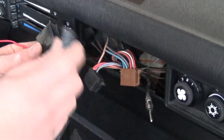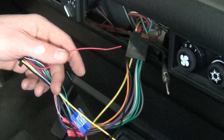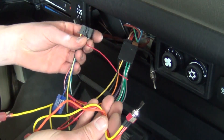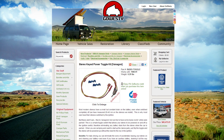With the adapter connected to the new stereo's harness, plug in the stock harnesses from the van to the adapter. The factory stereo of a van didn't utilize a signal wire. This is a red wire found on most newer aftermarket stereos. For this wire, we specifically designed a custom wired switch, found under part number radio-toggle on our site. Go check out the product page for a description of exactly how it works and a walkthrough of how to install it.